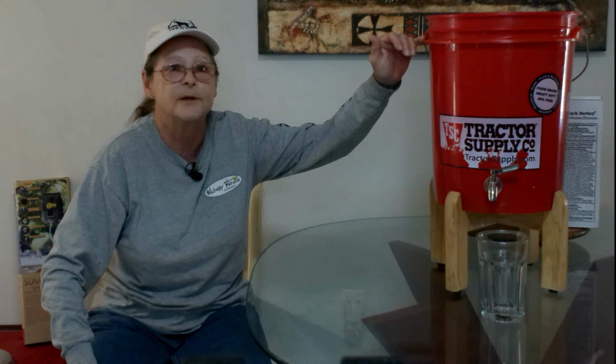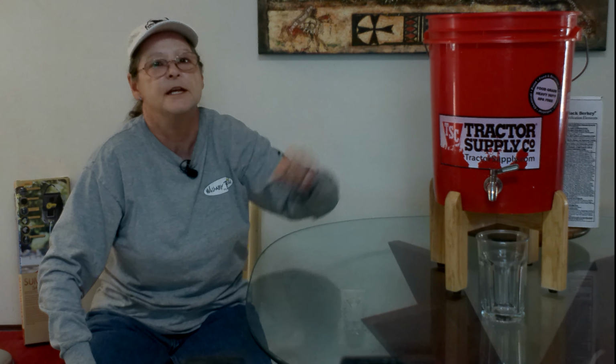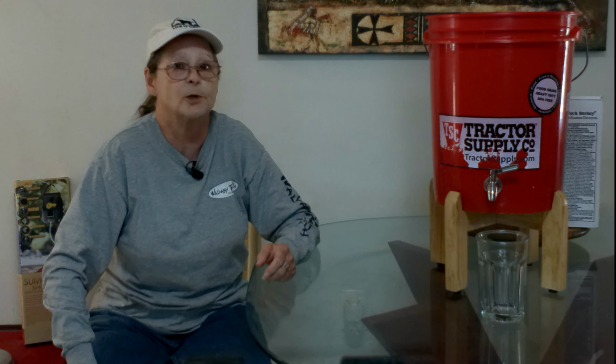You should also clean the water chamber every 3 to 6 months. Now here's your bonus tip. When using your water filter system, fill it up to the cover, the filters, 100% each time you fill it. You'll get better water flow. Your filters will wear evenly, and you're using the entire filter. If you're only filling it up halfway, then all you're doing is wearing out the bottom half of the filter and shortening the lifespan of your filters.